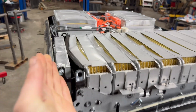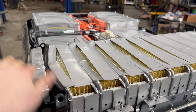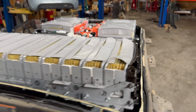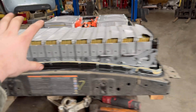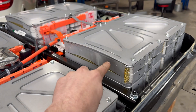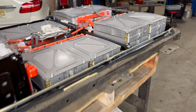The swelling is so significant that it's actually bent the compression plate here on this end, and probably a bit on the other end as well. This is the rear stack, which contains 12 of the 24 modules within the pack — literally half of the pack. The other half lives in the stacks at the front portion, and you can see the frontmost stacks actually have got some swelling too on some of the modules there as well.